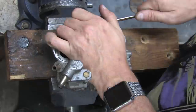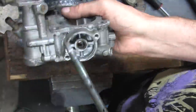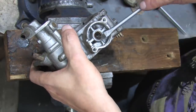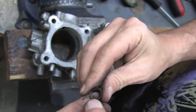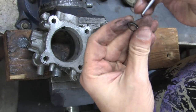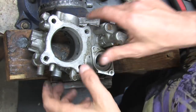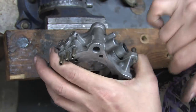The throttle linkage, spring separator, and springs are the same. The throttle shaft is different. The seals are exactly the same, and I remove them the same way. The rubber turns to plastic, just the same as it does in the older throttle bodies. None of them are immune to this. If you have strange idle anomalies, boost leaks, or part throttle drivability issues, it can very easily be caused by a leaky throttle body. Now you know what to do to address it.